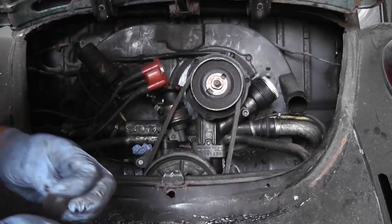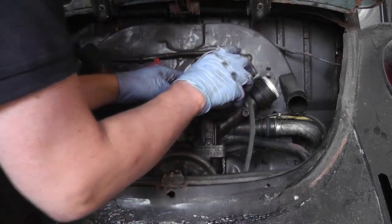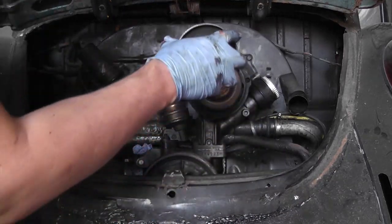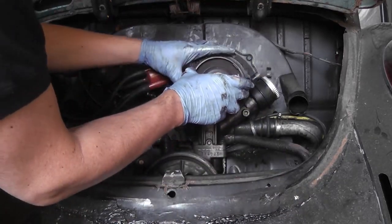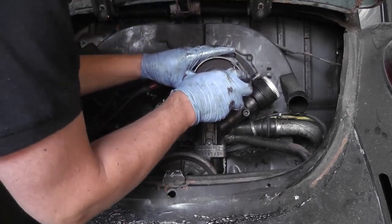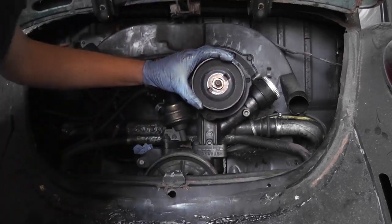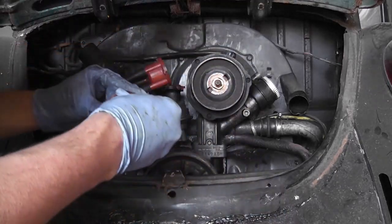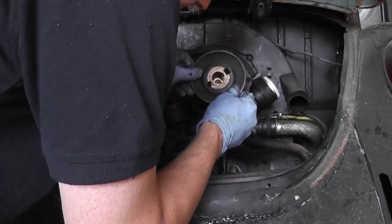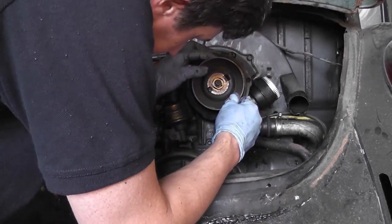So we're going to take off the alternator if we can. Basically the way you adjust the alternator belt on these is you have to shim out the pulley — by putting shims in between the two halves of the pulley it moves in or out, meaning the belt either rides higher or lower. It works, to be honest with you. You find those type of pulleys on other cars as well. I've never seen one with these slots in it mind — people with a lot more experience with these things than me.